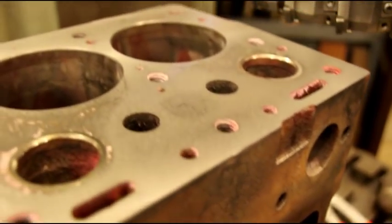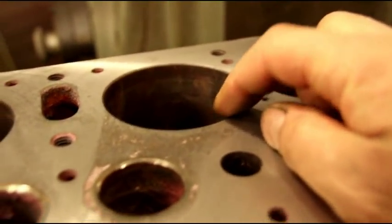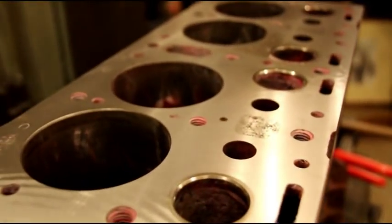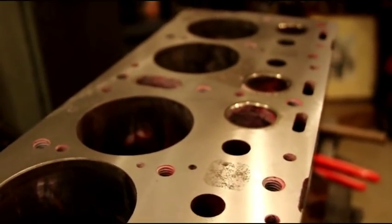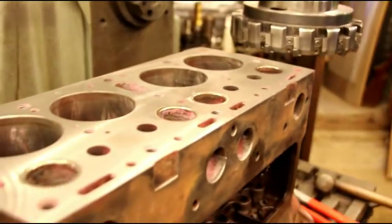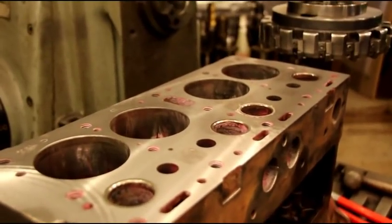We're ready for the next step. I won't be boring this today — I've got to get a few new cutter bits and a chamfering bit for the lead-in, and those should be here any day now. As soon as they come in I'll show you how to set up the boring bar and we'll get the block bored. I also need to get some bearings for the crankshaft. Things are happening, so there is a properly decked F-head block — thanks for watching and I'll catch you on the next video.